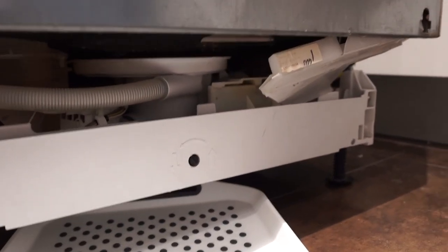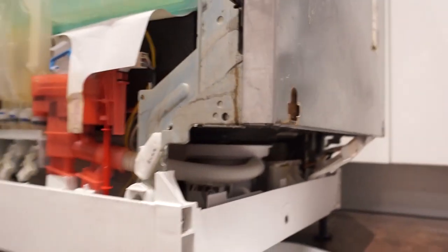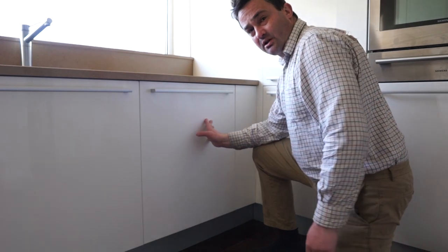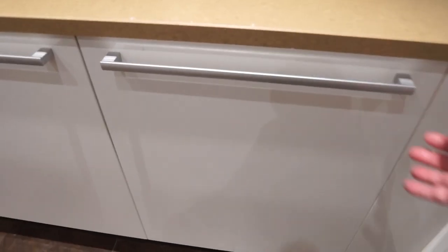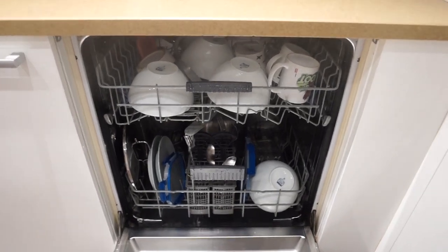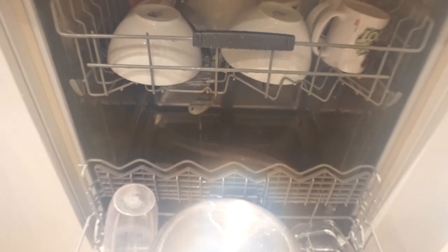The hose just joins back in as it did before — it's just a push fit. Make sure that goes in snugly, and then around to the front — push that in and once the camera is round I'll give it another push with two hands to make sure it's secure. For the rest of the reassembly it really is exactly the same as it came off: the side panel goes back on, the decorative door goes back on, and the whole machine slides back. We can power it up and check that it's working. Now running a normal cycle with a tablet — as we open the door there's a fair bit of steam, which means the heater is working properly.